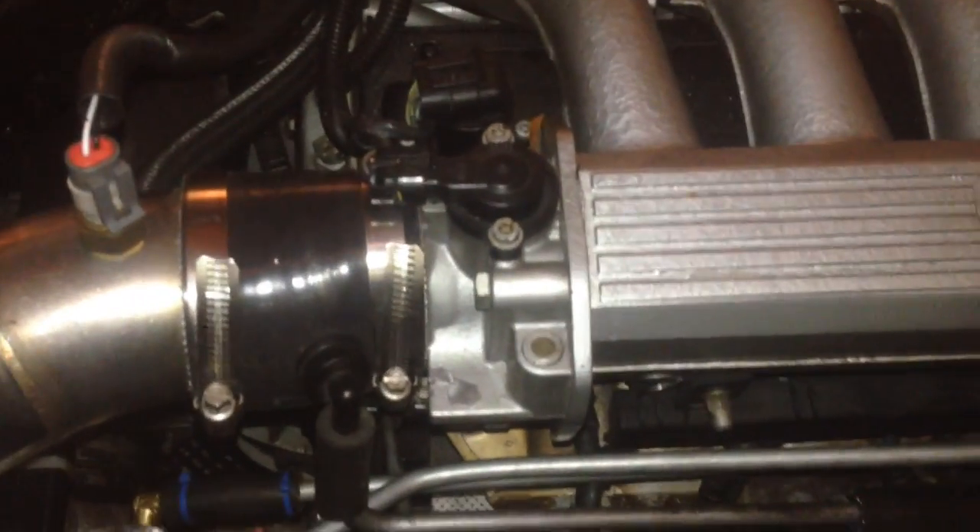This engine is not like most engines where it has an air inlet to the crankcase. This one only has vacuum ports drawing air out of the crankcase, making it a vacuum in the crankcase. Since I added different throttle bodies, when the throttle is released and the throttle plates close, it creates higher than normal vacuum in the intake manifolds.